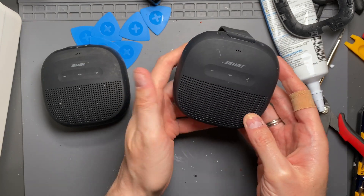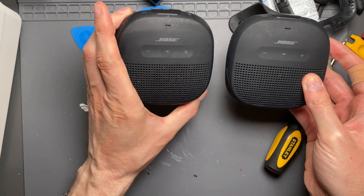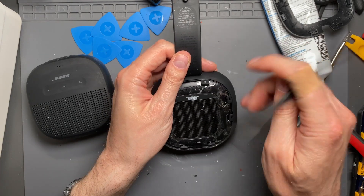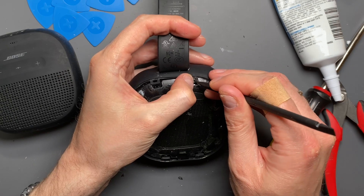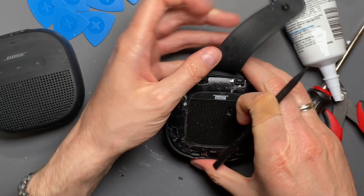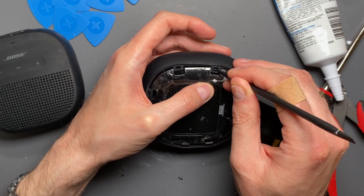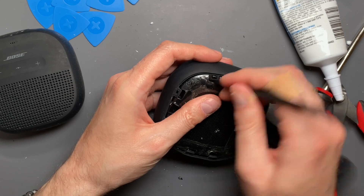We got this back on here again. Despite the nastiness around here, it fits in here nicely — it looks just like the other one. All I'm going to do is grab it with just a spudger tool and fit these little pieces over with the needle point, like that. I'm just going to repeat this for all remaining seven little pillars and then push this up to make sure it's all snugly captured around the corners too. Because it is silicone, if you don't get it captured on the corner, it's going to look a little bulgy on the outside and won't look like it did before it was taken apart.